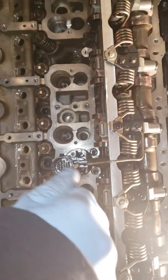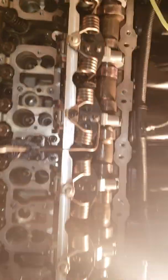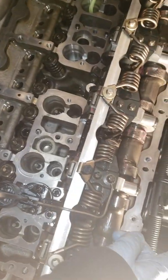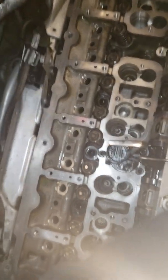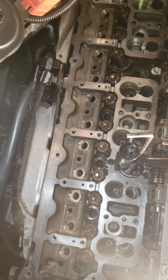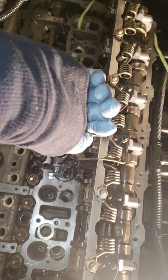Your goal is to set this all the way to max lift, let it sit there, plug up the hole you made, and then unplug the eccentric motor — do not plug it back in. The car will stay at max lift and will control airflow with the throttle valve, and it's going to run just fine. It might idle a little funky because you're at max lift at idle, and might need a little tuning for that, but I ran my car for almost a year like that without any issues. Hopefully this helps someone out and gives you the idea of what exactly you're doing here. Let me know if you have any questions.